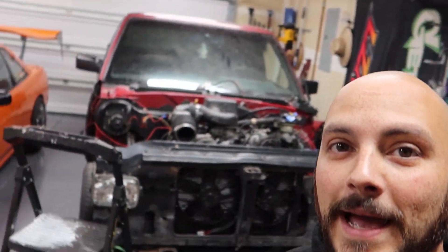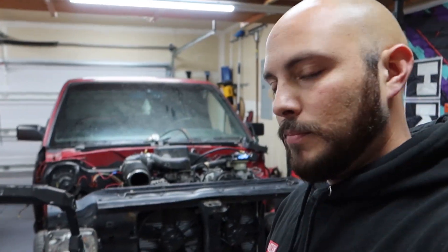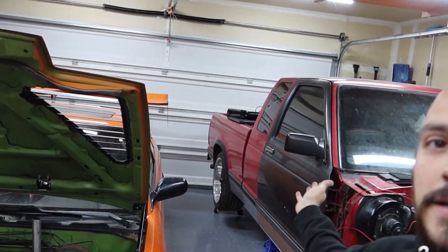Alright guys, we're back at it. Let's try and stay positive. Got a fuel filter thinking maybe it's just clogged because it was sitting there, and when I primed the pump it put a bunch of dirt in it. Well, I got a DW200 fuel pump. Turns out I learn something new every day - this was a carbureted truck, so the fuel pump in the tank was for carbureted engines. It only puts out like 12-13 PSI; I need 55.